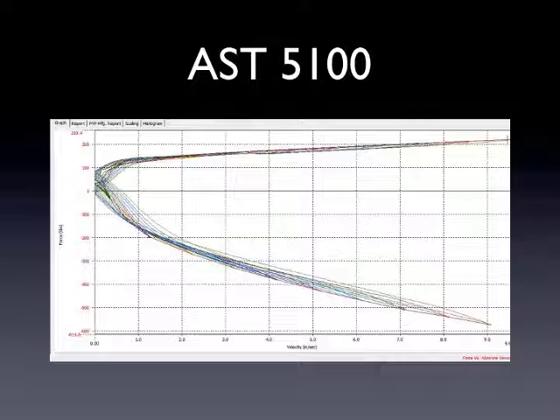I took the CVP plot and then added all of the CVP data to it. You can see that the lines are very tight running the plots against there. This is not a direct comparison to some of the other ones, but if you look back at what we call the venerable old standby, this is a similar plot to that. You can see how the compression overlays on top of itself nicely. We've got a little bit of leakage down at the very low speed, but we even saw that with the highest of high-end shocks. If you were to go back and look at a half inch per second or one and a half inches per second, you would see how tight the plot is together at those lower speeds.